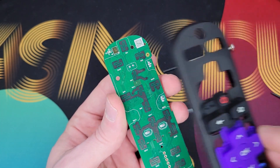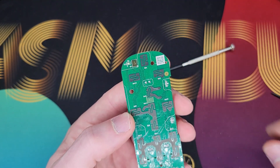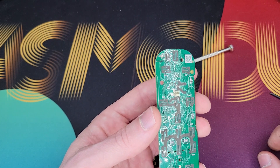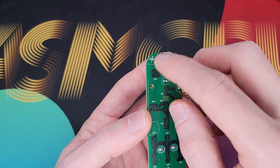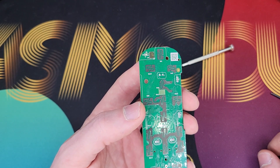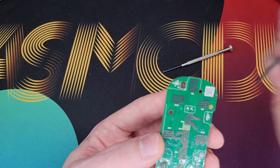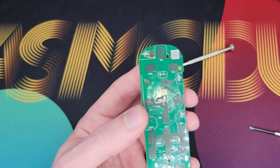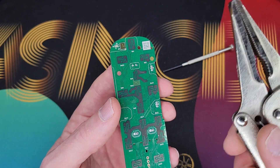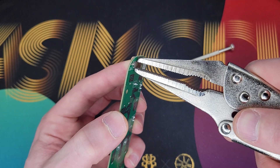Right here — there's the microphone. See, it just sits right over that like that. This is what you want. Let's get that wiretap out of there. So obviously if you remove this, you are sacrificing any voice search or voice command options — it's pretty self-evident, but just wanted to clarify. I did see some suggestions about covering the microphone itself or even the hole on the remote with some hot glue or something similar, then removing it when you want to restore the microphone functionality. But I didn't care for that — I wanted it completely gone.